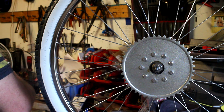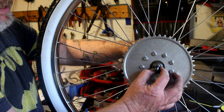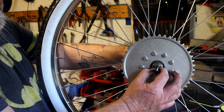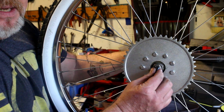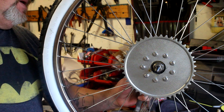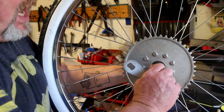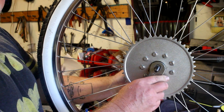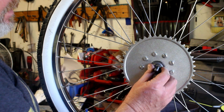We'll get some excess grease out. I'm going to hold this and screw in on the axle until I get it snug — I can feel it starting to take up. Once it's snug, check for any wiggle. I take my 17 millimeter wrench, back up the back side, then take the brake arm and snug it just a little bit — if I get it too tight it won't spin easily. As you tighten things up, check it again and again. Snugged up and good to go — now let's get the dust cap on.